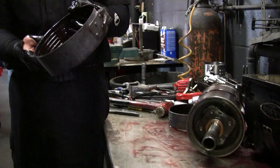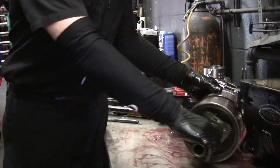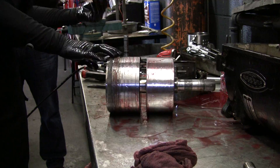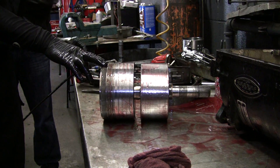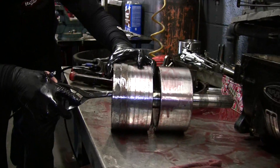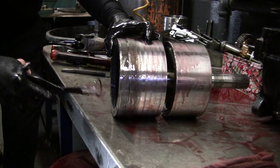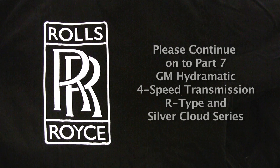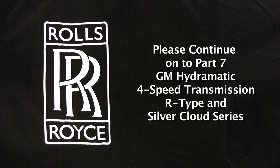Rear band. Now you've got your two drums here. That's a bad ring there. To get the drums apart you've got to take this rear snap ring off — another one of these. See how nicely that came out? One out of a hundred — usually it goes flying. Happily, full spacers! Yes!